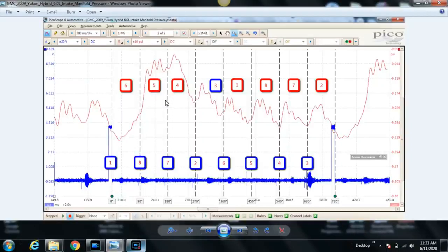And this is what I suspect is the case, because again, in hindsight, cylinder number 5 is fine. You're not seeing it because cylinder number 5 is on an intake pull, but cylinder 6 is not. So you don't have two cylinders again pulling on the intake valve at the same time. Cylinder number 4 intake valve opens, pressure increases, and during the intake stroke, the pressure drops. So that's what we have going on here.